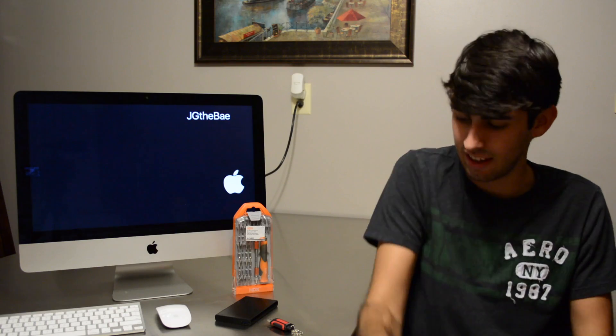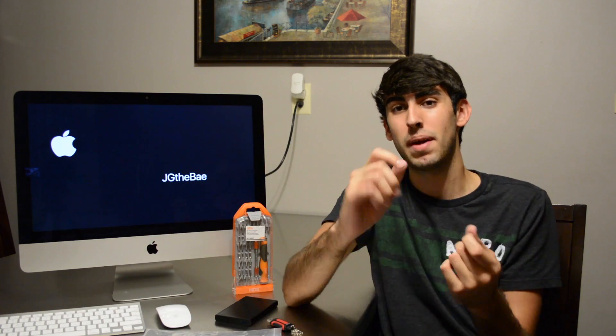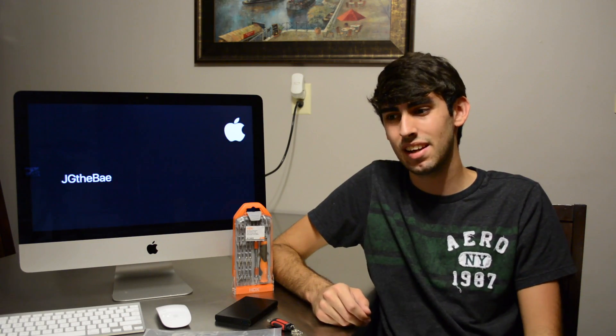Now let's talk about the performance of the Mac. I put a 240GB SanDisk SSD in it — the SSD Plus. I didn't do anything special, I didn't go with a Samsung or anything. It's 240 gigs and I just installed it — it fit in the exact place of the hard drive. You just need to make sure to get the adhesive off of the rubber mount for the hard drive, get all of that adhesive off, and then put the SSD in it.